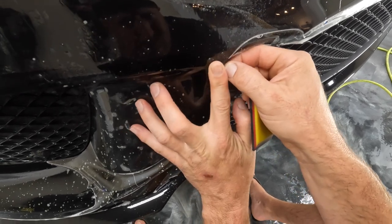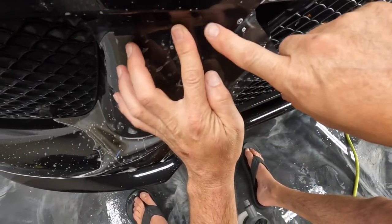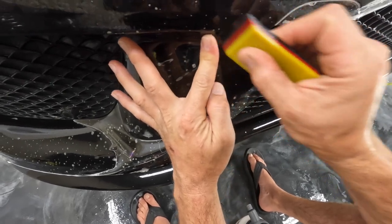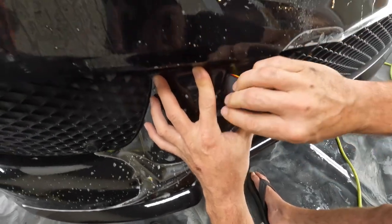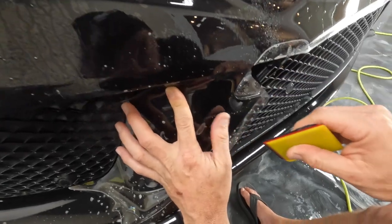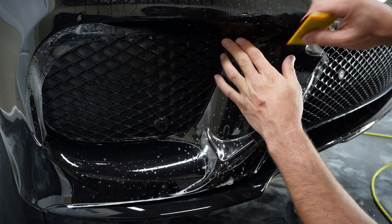So when you're putting these seams together, you'll notice that I spend quite a bit of time at this seam, and that's because I want the seam that butts together incredibly well. I want that to not hold wax over time. And so I'll spend many minutes pulling the material back up, pushing it back down, and just making sure that I get an incredibly tight seam.